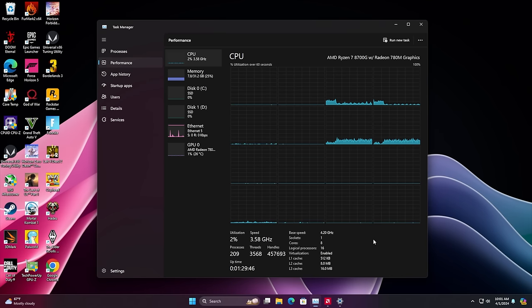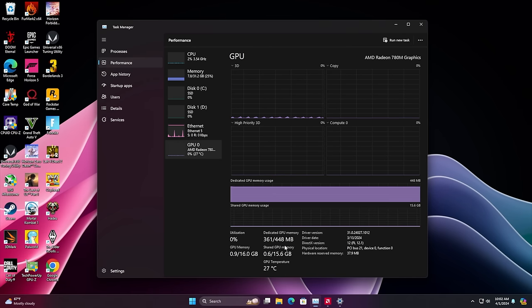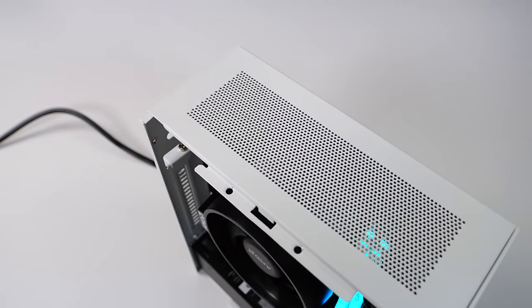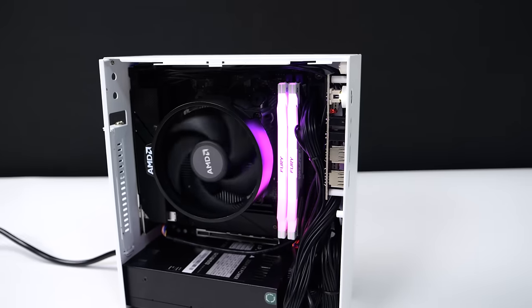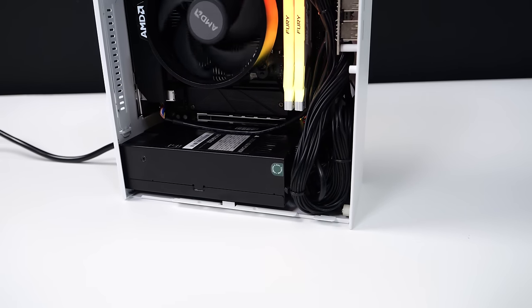As a lot of you know, I've been a big fan of AMD APUs, and the 8700G is turning out to be one of my favorites. The base price of the chip is a bit higher than everyone wanted, but you can also pick up the 8600G for less performance at a lower price. Getting into a small form factor PC like this with the 8700G is a great way to start, and later you can always add a GPU in a larger case. This is performing on par with something like the 7700X for CPU performance, and out of the box you can game on it as-is while saving up for a GPU. I used a relatively cheaper case to help offset that RAM cost — the 8000MHz RAM is a bit expensive. Going with 6800MHz RAM gets you out much cheaper with almost the same performance, roughly a 12 FPS difference between the two, so I'll also leave links for that cheaper 6800MHz RAM.